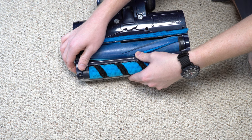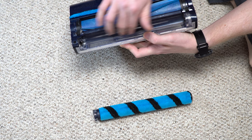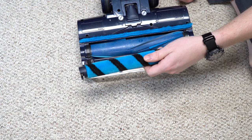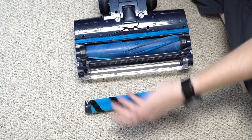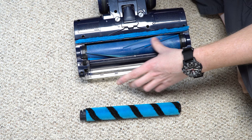They're not counter-rotating — they're synced together. And one of them comes out, and you notice it's two different colors. That's really going to look great in ad literature. But you notice the first spinning brush — there's no way for the suction to get into it. That means this spinning brush here just spins. It's just for show. That's all it's going to do. There's no way for suction to actually get to this front brush, which makes this nothing more than a showpiece. So the actual cleaning is being done here with this brush.